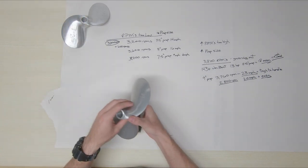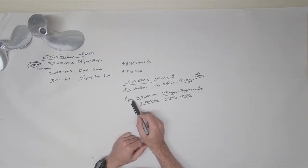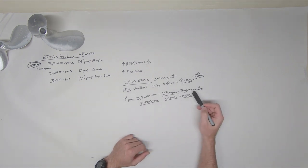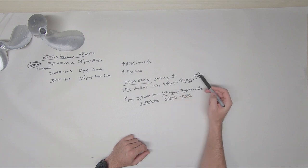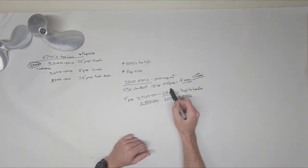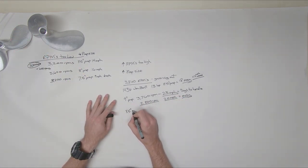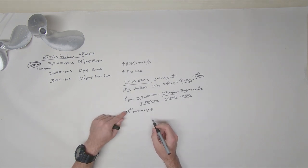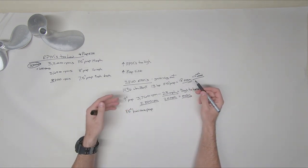As I explained, I'm running the nine inch prop and I'm still just under 3,800 — it's the perfect RPM range but it's too tough to handle because I'm over-propping at nine inches. Eight and a half seems to be the sweet spot. There's also an 8.75 I can run, but standard props only go to eight and a half. This is where the Hurricane comes in: the eight and a half inch Hurricane prop has more pitch but the same diameter, so you should still get easy handling but go up in speed because you have more prop biting the water.